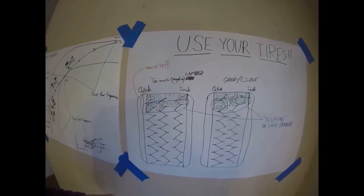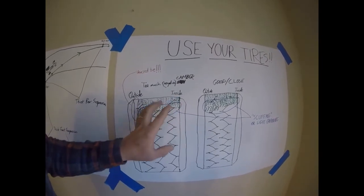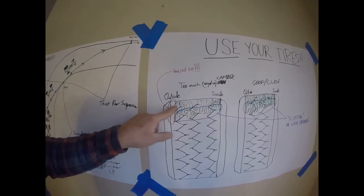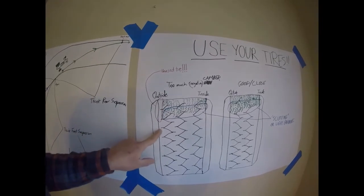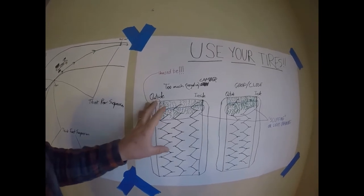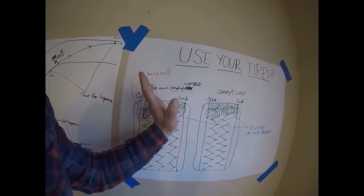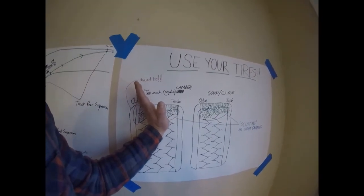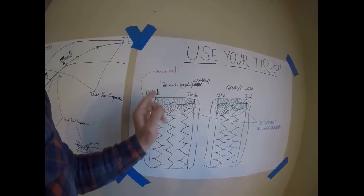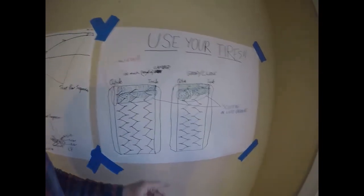A little bit closer view of that tire demonstration. The rolled up edges here, that's normal. But if you're not getting this graining pattern all the way to the outside edge and your outside tire looks fresh, you've got too much negative camber dialed in. Likewise, the opposite would be true. If you had too much positive camber, I don't know why you would have that, but maybe you decided to bolt these on a pre-war car. And if you got too much positive and this isn't rubbing, you got some major other issues going on.